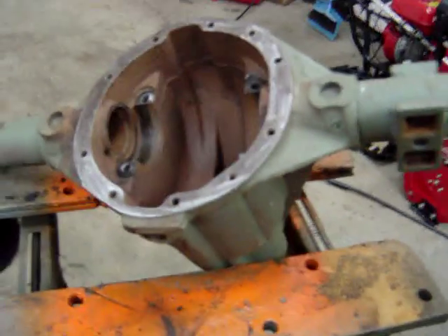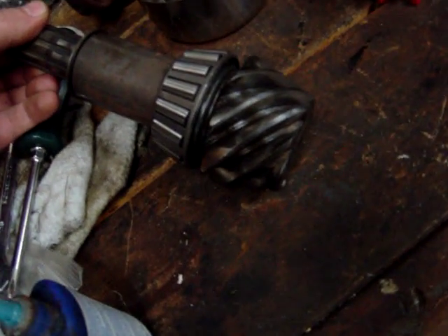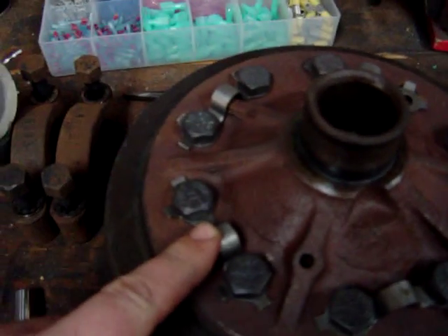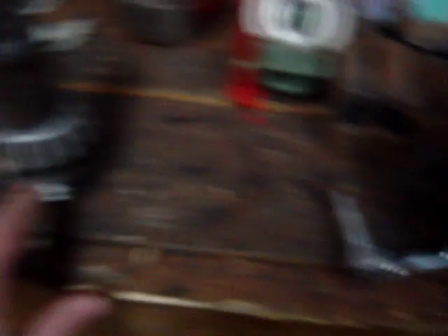This is soon ready for assembly. I need a few more bearings for the carrier. There's the pinion that I had shipped in — pretty good shape. I've got a new bearing put on that one, and the pinion itself is in excellent condition. I've got to recalculate all the shims because I've got to set up the bearing preload. Here's the original carrier — I've got new bolts in here with new locking tabs. This is the matched ring gear for this pinion; it came as a set — even though they're used, it's nice to keep the same pattern if I can. This one's in pretty good shape too. There's the original carrier.